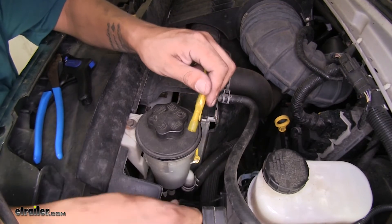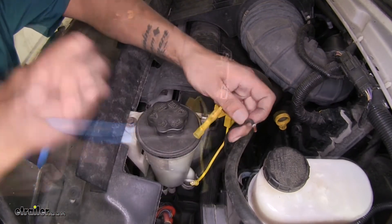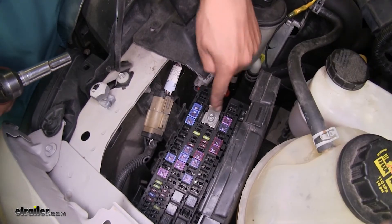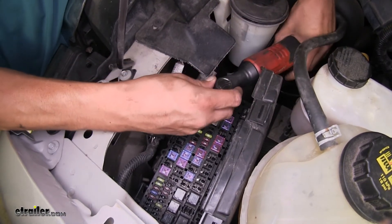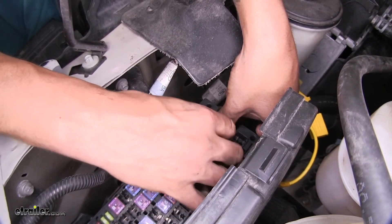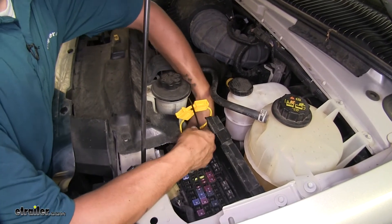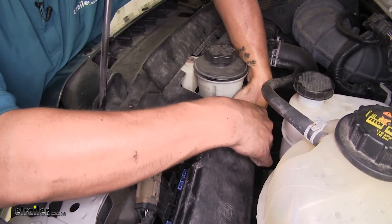We can take the end of our black wire, strip it back, and it's going to be going into that butt connector. We're going to need to remove that nut in order to get our ring terminal in place — we're going to be using a 10-millimeter socket to remove it. With the nut removed, we can slide the ring terminal in place and then re-tighten that nut. I'm going to take some of the provided zip ties that come in our kit and tie it to some of these wires right below my fuse box so I don't have any loose wires in my engine bay. Finally, we can take the 15-amp fuse that comes in our kit and put it in the fuse holder.